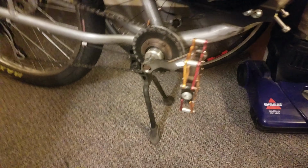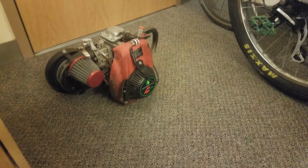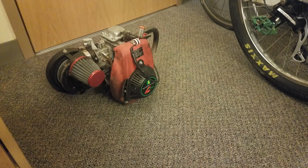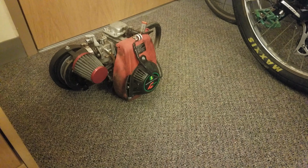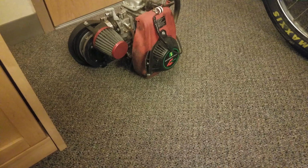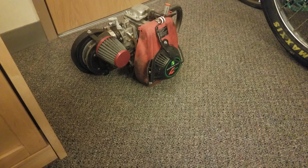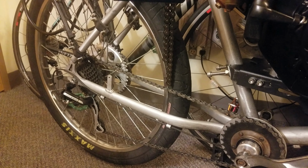So the reason why the Huasheng comes into this is because it's the old engine that was on the bike with the Grubee 4G or 8G transmission. It's the 20 tooth on the shaft and then 80 tooth belt on the back, going to a 10 tooth or 11 tooth sprocket that went to a 40 tooth on the back, which has also been changed on this bike to a 46.